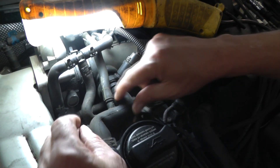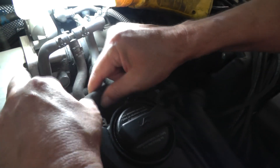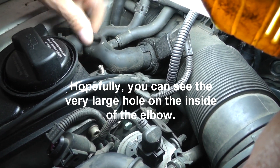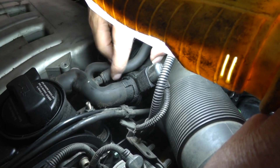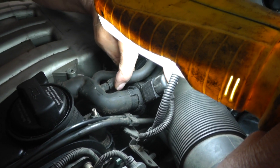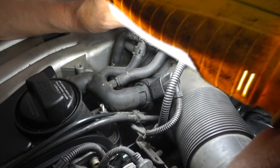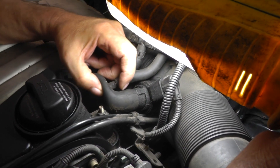There's another split here on this tubing right here. If you look on the inside and open it up, you can see right there — this tubing is dry rotted. I've already seen that with just this inspection looking over, and I didn't see anything else obvious. But later on I'm going to do a smoke test on the whole vacuum system.